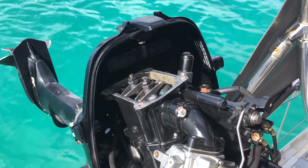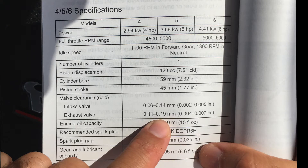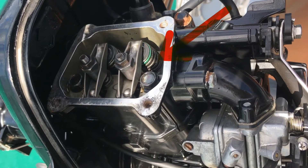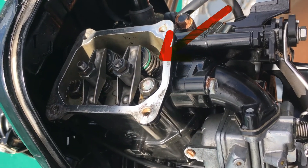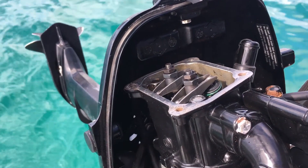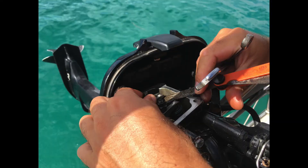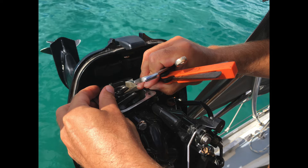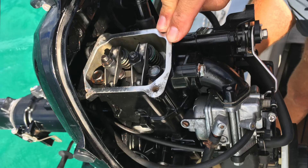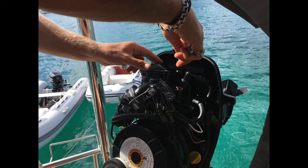In order to see what gap to leave we look at the manual. You can see the intake valve and the exhaust valve gaps specified right there. To differentiate the intake valve from the exhaust valve you basically just look at it: the intake valve is the one closest to the carburetor, and the exhaust valve is the one closest to the manifold. Before we set the gap we need to turn the engine to the position where both valves are closed. Then you insert the feeler gauge between the valve and the lever and tighten the nuts so they're snug with the feeler gauge in place. After you remove the feeler gauge the levers will be a little bit loose — you can touch them with your finger — and then you put the cover back on and start the engine.